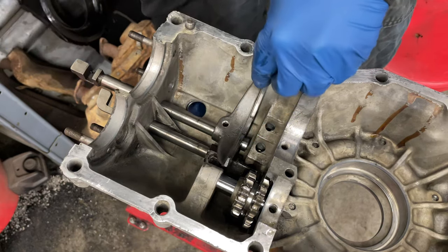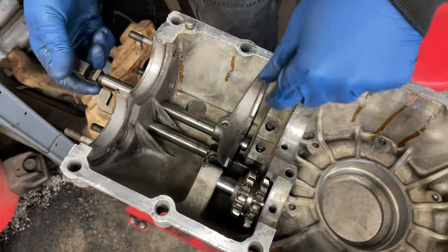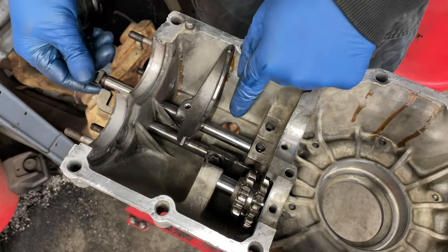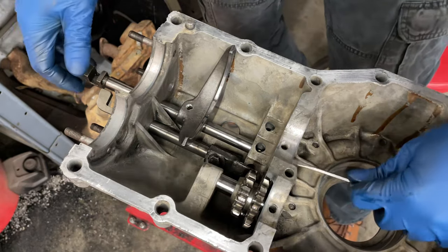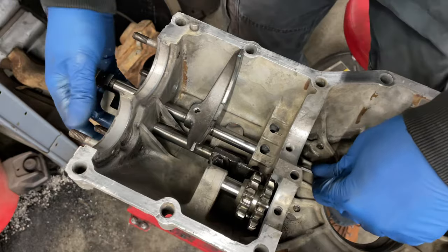That, and there's an access hole on the outside. I can't see it, but there's two of them here. There's this guy and this one, and that's to adjust these forks while everything's together on the outside of the box. So now that this is in here, I'm going to get that started a little bit, and then get my screwdriver in there to do the detent ball like that, and then hopefully I can just...